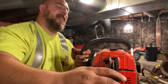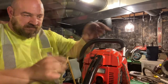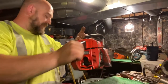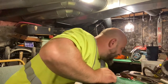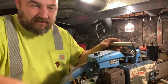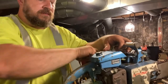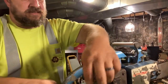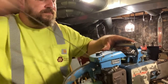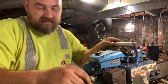Let's pull the spark plug out and see what she looks like. I'm going to pull this saw up here and pull the spark plug out of it, just to make it easier. Good spark — let's see what this one does. That one's got even better spark. The one that was in the 360 has great spark, so I don't think it's the spark plug.